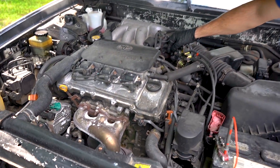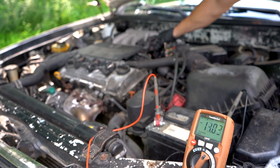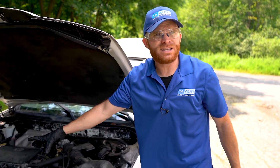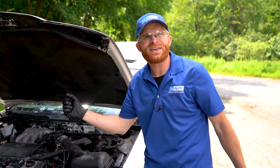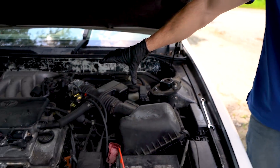Let's go ahead and rev it up a little bit. Even with the RPMs up and loads on there, the alternator was really only pushing out approximately 14 volts to the battery to try to charge it up. Why? Because inside the alternator on this particular application, it has an internal voltage regulator. Essentially, that's going to make sure the alternator can't just put out a thousand volts just because I'm jamming on the accelerator pedal — and of course that's for the safety of all the internal electrical parts of your passenger vehicle.